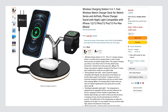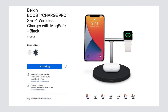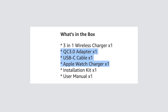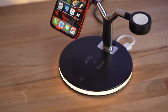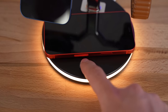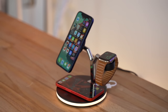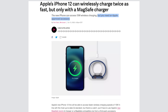Now moving on to a 3-in-1 stand we found for $50. This one's very similar to Belkin's 3-in-1 stand that you can get from Apple's website for $140, which we absolutely love — other than the price. For that low price, not only do you get the stand itself, but it also comes with a power brick, cable, and Apple Watch charger, unlike many 3-in-1 chargers on the market where you have to provide your own. This thing also has a really cool LED light on the bottom which briefly glows to indicate charging has started, and a touch-sensitive button on the base to adjust brightness. Now this stand claims to charge at 15 watts, however that's impossible because all three chargers have to share the same power brick, so the wattage is split up among them. And no third-party MagSafe charger can deliver full 15 watts anyway, because Apple only lets their devices accept 15-watt wireless charging from their own approved accessories.